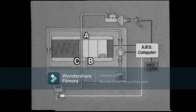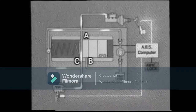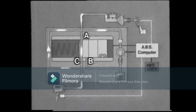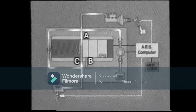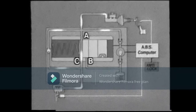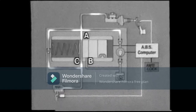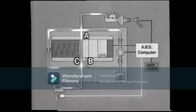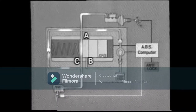As an example, let's take a look at the operation of the brake system of one front wheel. Under normal braking conditions, when slip between the tire and the road is rare, the anti-lock brake system does not operate. In this situation, the three-position solenoid valve does not operate. Port A remains open and port B remains closed. Brake fluid pressure is applied to the disc brake cylinder through port C. When the brake pedal is released, the brake fluid returns to the master cylinder from port C through port A and the number three check valve, so that no fluid pressure remains in the disc brake cylinder.